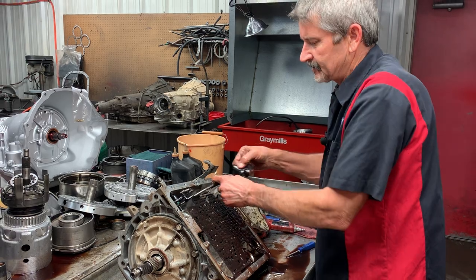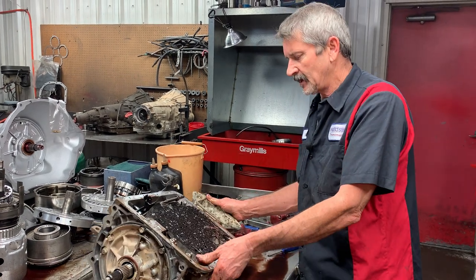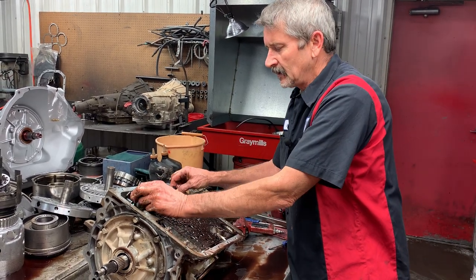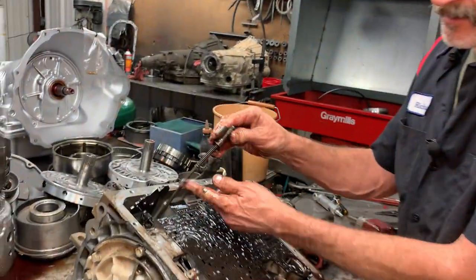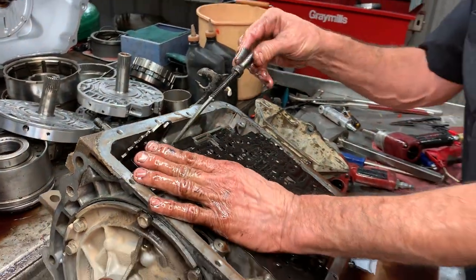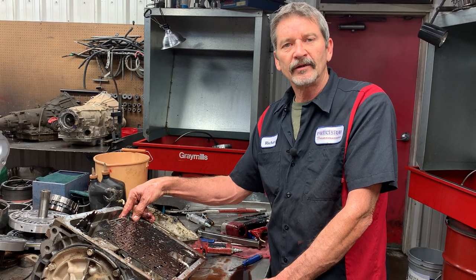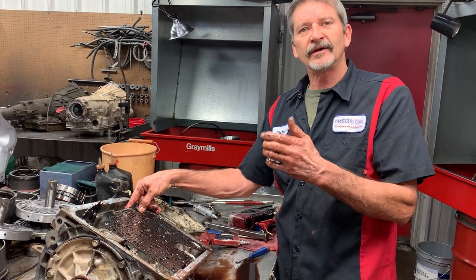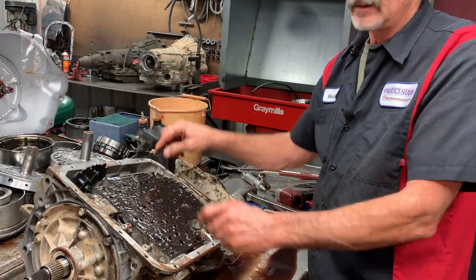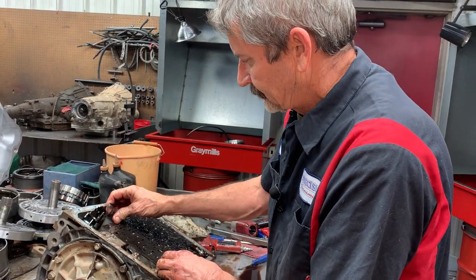Getting our parking linkage off. I had a gentleman on my Precision fan page on Facebook - when he put it in manual low he would hear a clicking noise. Anytime you bend this rod right here - I've done it before, putting it in a parts washer on these trannies and on 350s - it bends. When you put it in there just a little bit off, it'll push that lever over, barely trying to put it in park, and you'll hear that clicking only in manual low. Move it up to second and it goes away. All you gotta do is come in here, try to figure out where you bent it, just bend it back, put it back together, and look at it under the car with the pan off to see if it's still doing it.